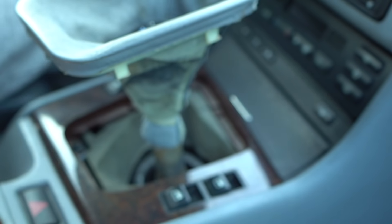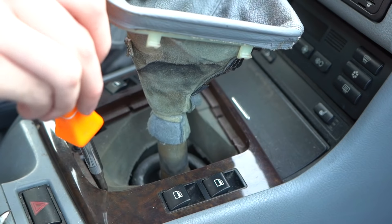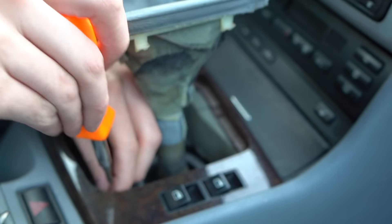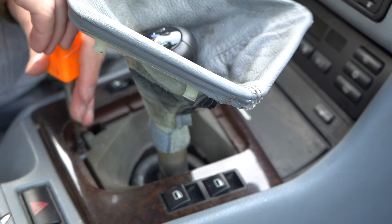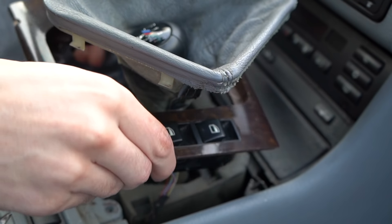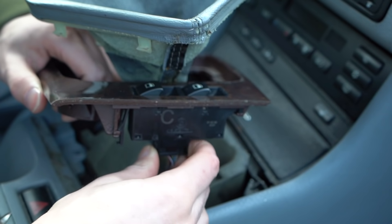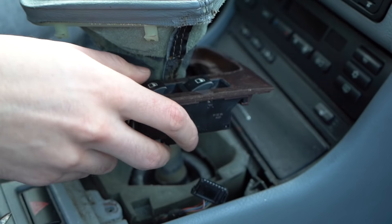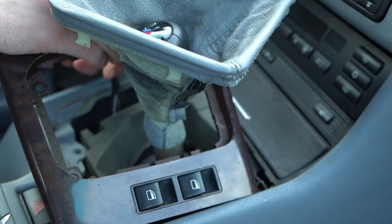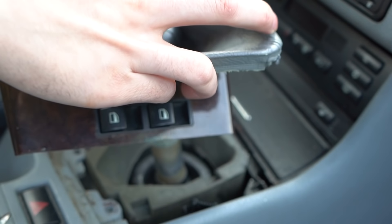Pull it up like that. The next thing you need to do is remove the two Phillips head screws — there's one right here and one right here, just remove them. Now that those are removed, lift up on your trim and it will pop off. There's one wire connector — push the pins, two pins on each side, and it should pop right off. The connector looks a little different on the other side but do the same exact thing.